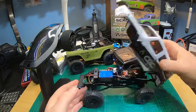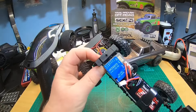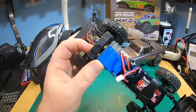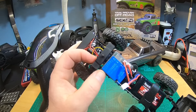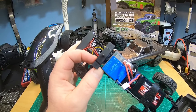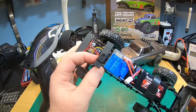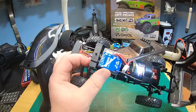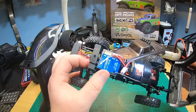Before I want to compare the radios, the most important question many of you probably have: yes, it's true — the new receiver unit, the HRZ00015 from Horizon, does not have a channel 2 out. So it's impossible to use an external ESC like the FuryTech ESCs or ModelBau Regler DE ESCs for your SCX-24 with the stock electronics. You will have to change radio and receiver if you want to use a better ESC.